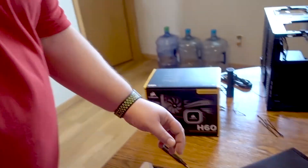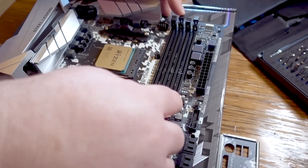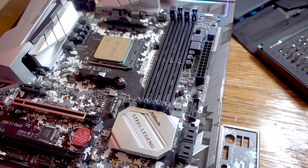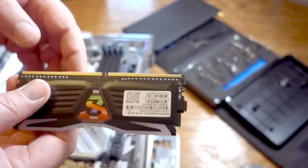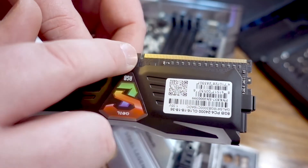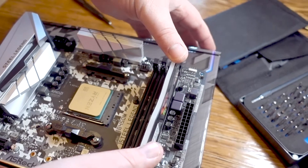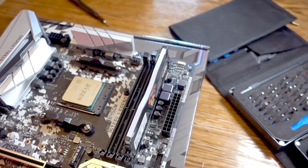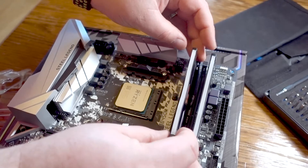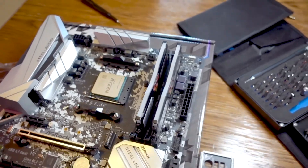Let's do memory next since that'll be the easiest next step. You need to verify from your manual which slots to use. For our purposes we're going to use the A1 and B1 slots — you can see they're labeled A1, A2, B1, B2 on the board. So we're going A slots. The RAM is all keyed, so you see the little notch — it lines up in the slot. Just put it down, lining up that key, and firm push in until you hear a snap on both sides. We've installed a DIMM. Same method for the second one — push down firmly until you hear a snap. We got our snaps, so we're good. RAM installed.